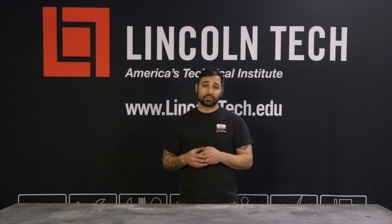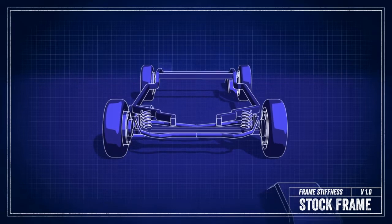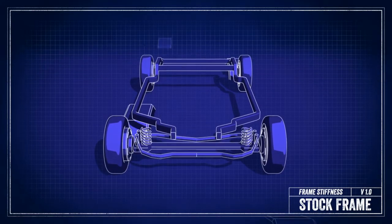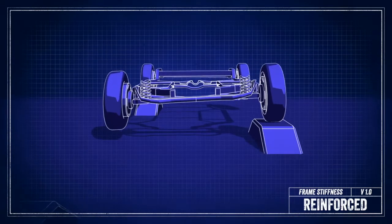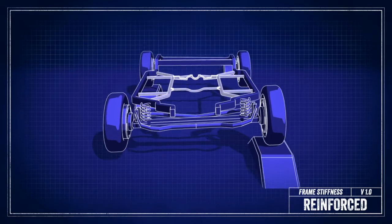The second main advantage of stiffening up one of these old cars is actually comfort. These old loosey-goosey frames on the highway will bounce and resonate and create all these weird harmonics — the car is basically bending and twisting all over the place. That can all be fixed once the frame is properly reinforced and stiffened. Then your shocks and springs can work as they were designed.